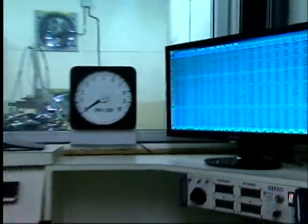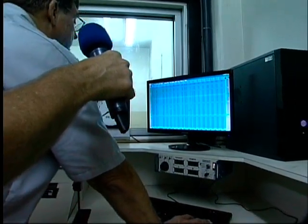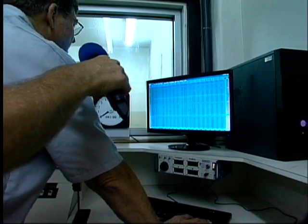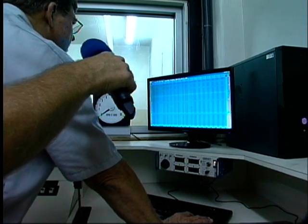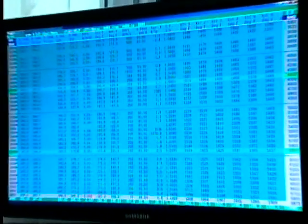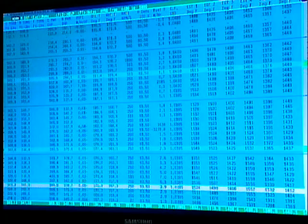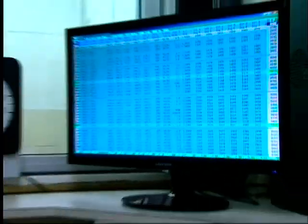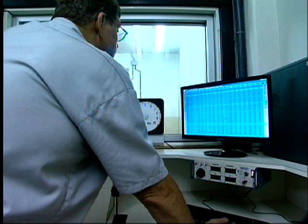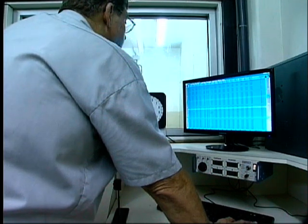385 is the best on the first pull. All these numbers you're seeing on the screen tell us at different RPMs what horsepower and what torque she's making — oil pressure, temperature. You can see it there on the screen. There's a lot of numbers to study.